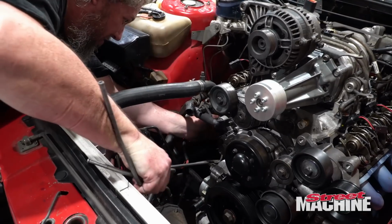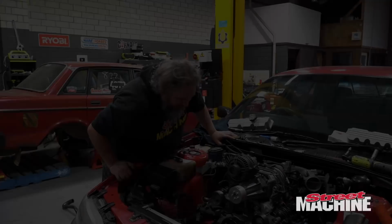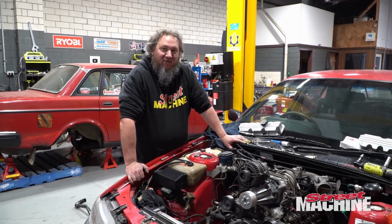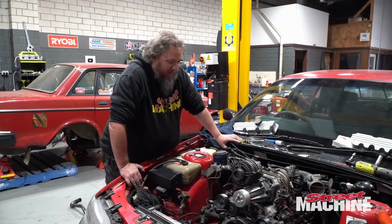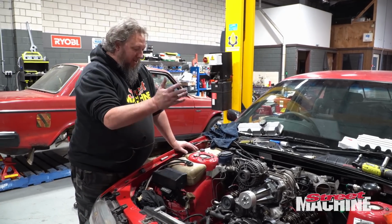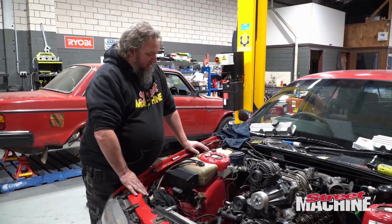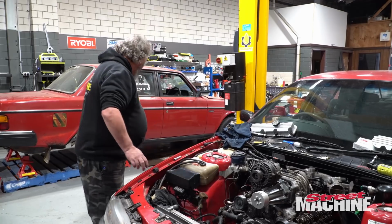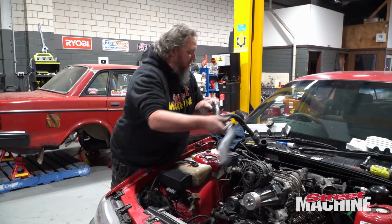Wow. Well, that was painful. I won't forget to do the trans lines into the engine bay first anymore. Yeah, that set us back a few hours. Had to remove everything, basically. Well, not the engine, but had to remove the engine mount, the pipes, all again, just so I'd get the trans lines in there. Engine mount back on, pipes back in there. Now we've got our big crossover pipe, put that in as well. It's not too hard, thankfully.